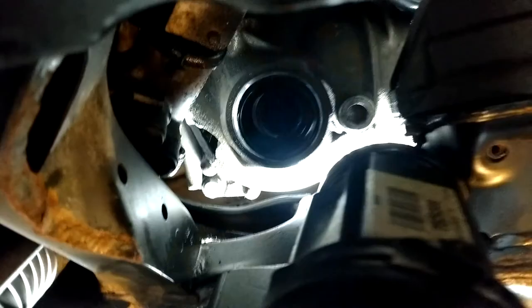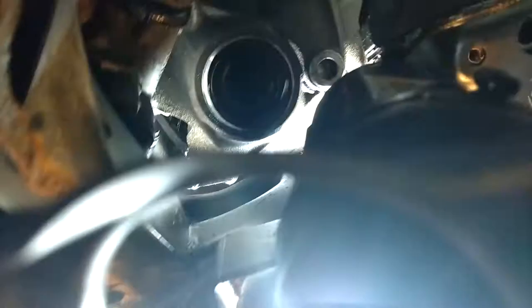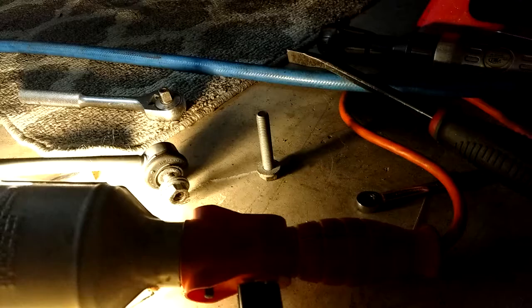There are four bolts that bolt from outside the left wheel well into the oil pan. The two on the bottom are easy enough to get to. The one on top is visible and I can move that hydraulic line to get to it. The upper front one is really difficult - I used an extension on a wobble socket to reach it with an impact wrench. It came out fairly easy and you can reach it with your fingers to insert it.